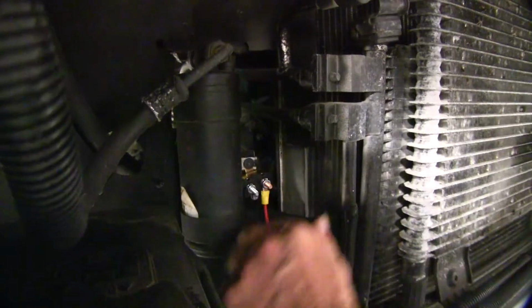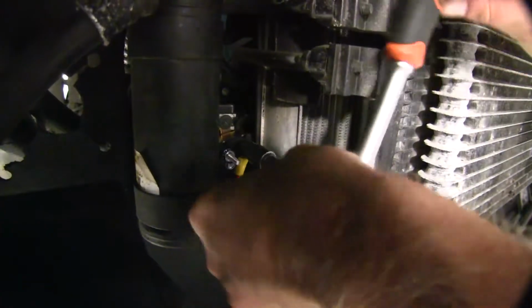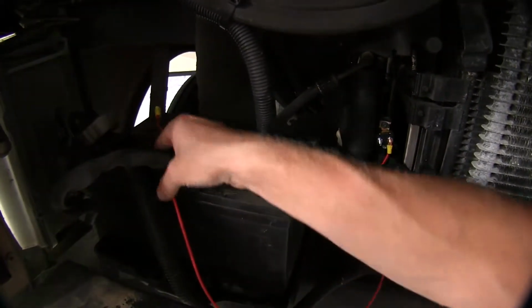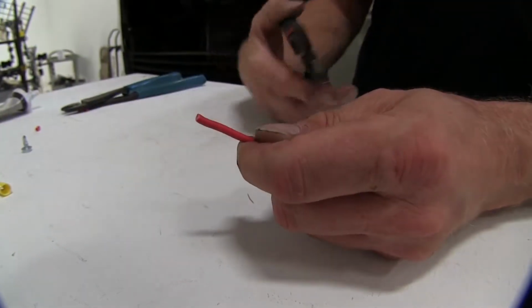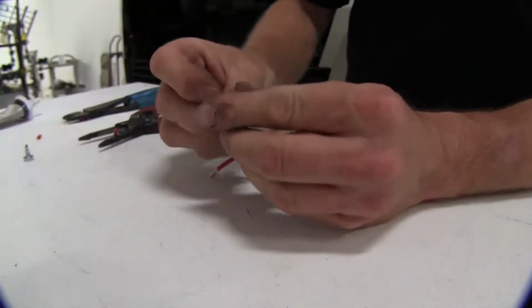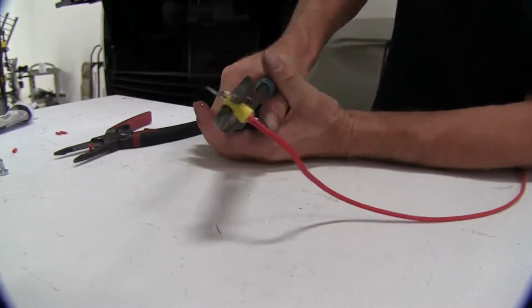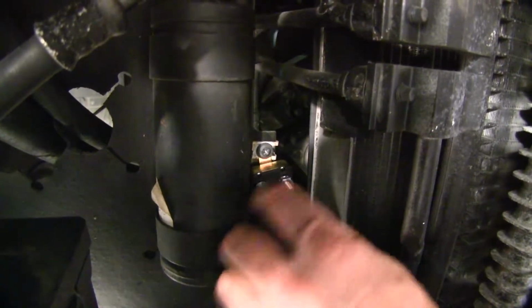We'll tighten down the nut using a 3/8 socket. Now we'll leave this end of our wire unconnected, as the connection to the battery is the last thing we do. That way, when we run our other wire towards the back, we don't create a short. Now for our leftover long length of wire, we'll add our other small ring terminal to it. Okay, we'll take this wire and add it to the remaining terminal on our circuit breaker.